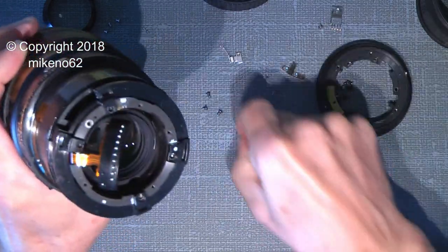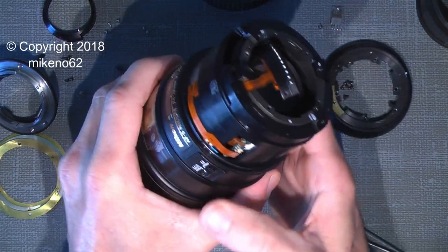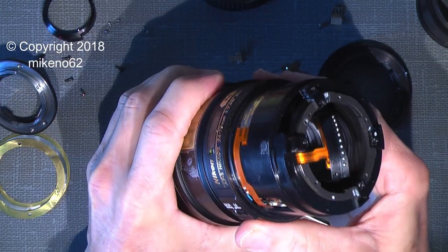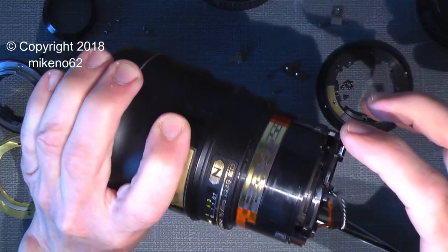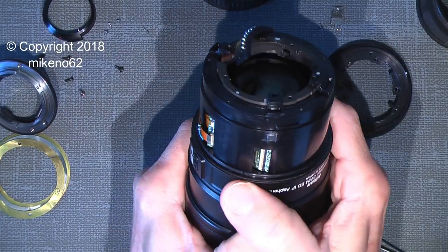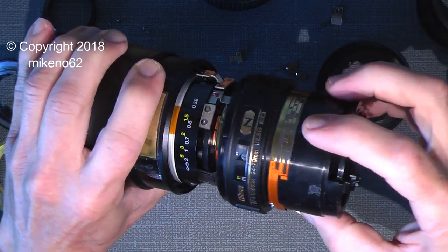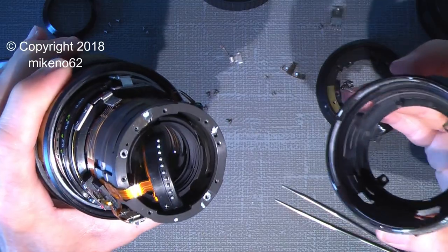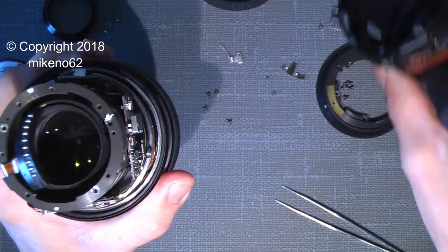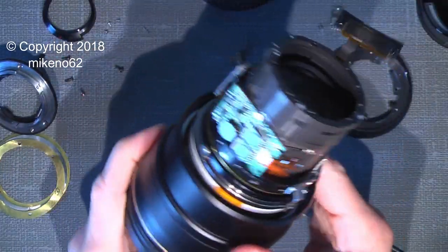Off with that screw. Gently lift off the zoom encoder tube — have a good grip here and on the focusing ring over the front section — then wiggle it a little and take it out. I already lubed it yesterday and it works pretty good. Now inside the lens, the focus ring comes off and you can see part of the lens which includes the focus encoder — the magnetic strip, the magnetic tape.